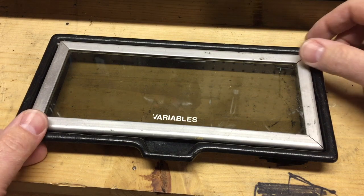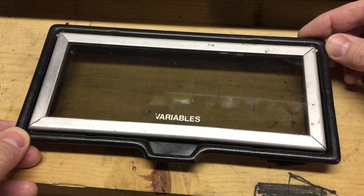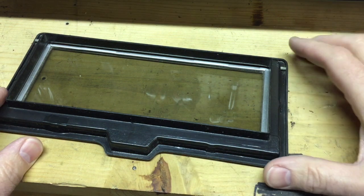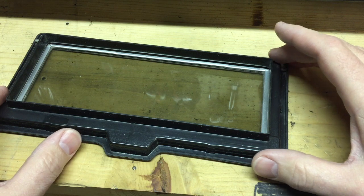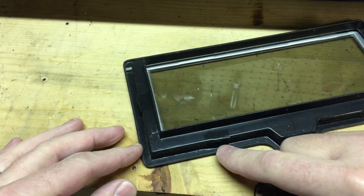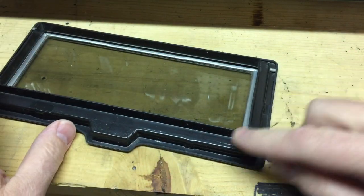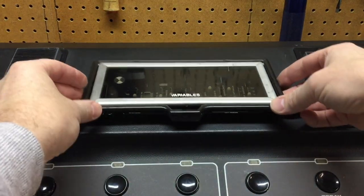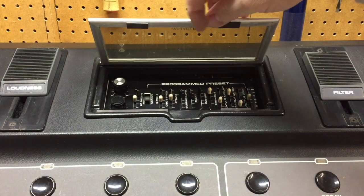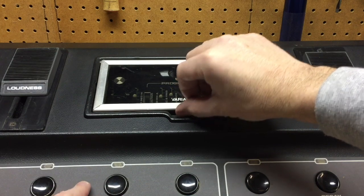For just about the last step here, we're going to talk about the variables door. As you probably know, these things tend to go missing. This is the original one to this unit, which is kind of amazing. They're held in by these little nubs that bump out on the plastic and they're just sort of wedged in there. Naturally as time goes on and the plastic contracts as it gets older, they don't hold it anymore and they fall out. So what I've done is taken a little bit of electrical tape and just dropped it over the nub at all six points, then take the door and slip it in place pressing at all six points — now it's not coming out. I was also able to replace the magnets on the door. I think some of the portions are missing, but I was able to get enough of it on there in such a way that it actually stays closed now.